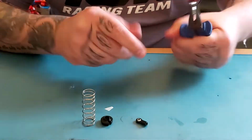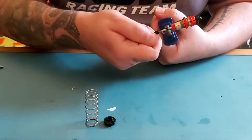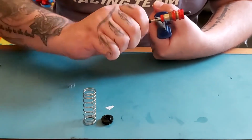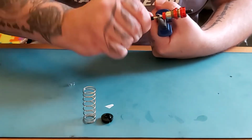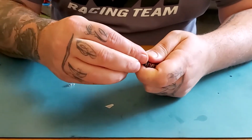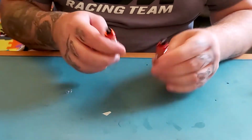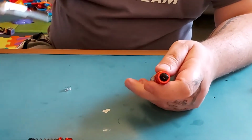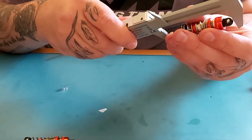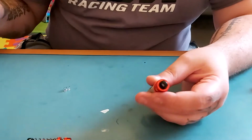So we've got the end cap to put back on. They take a while, these. Right, so that's on. Spring back on. End cap back on. Same ride height. So if that was the rear of your vehicle, you'd have two exactly the same, and your ride height will be 5mm lower, which would be bringing your drive shafts more centre. So that's exactly the same size.